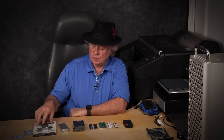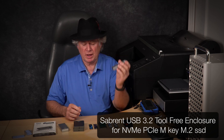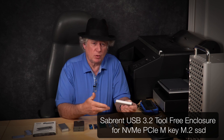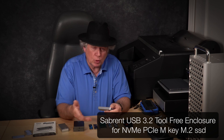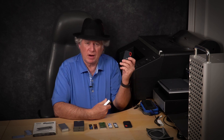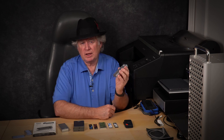If you're doing a little video you might want to go a little faster, and that's where this one comes in. This is half the price and it's USB 3.2, which is the same as USB 3.1 gen 2. I know it's confusing - basically they renamed USB 3.1 gen 2 to USB 3.2 and still use the gen 2 designation. USB 3.1 gen 1 is the 500 megabytes a second standard. Anyway, the cool part about this enclosure is it doesn't take any tools.